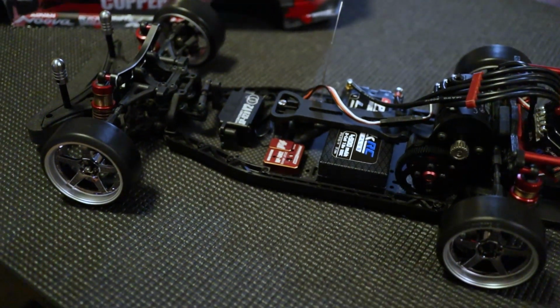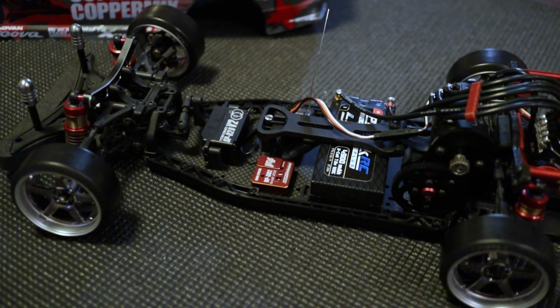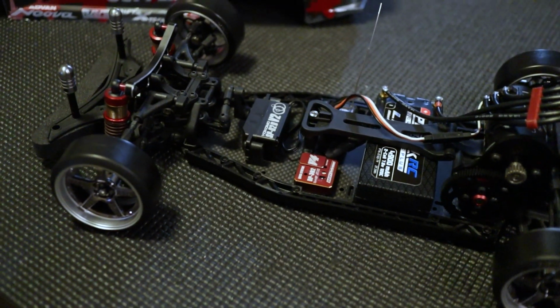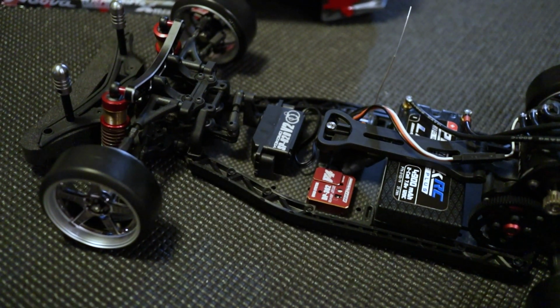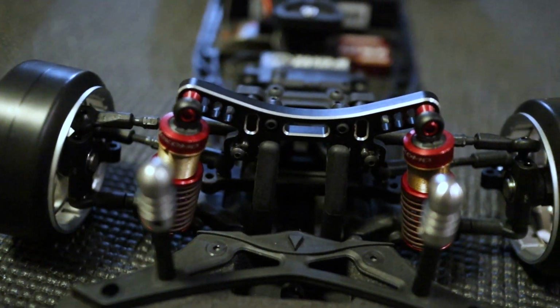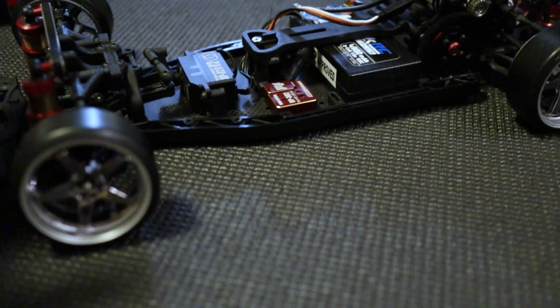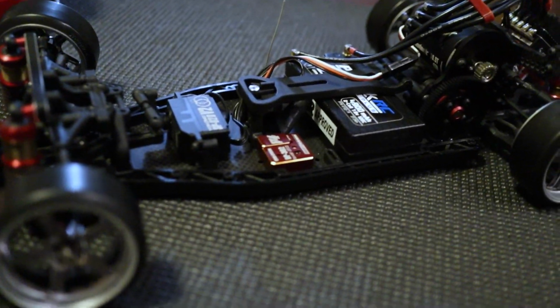All right, well that was the basic alignment setup there. You heard Shane talking about what we needed for front camber, rear camber, and front toe. Basic initial setup. He did give me some advice on what to do, so I have this kit set up for each shock. So basically, front and rear on the upper mounts here, I want to stay in the top, but go in one on all 4 corners. He said my ride height that I had it set at is pretty good, even though on the rear it seems super low, but he said that's how we want it.